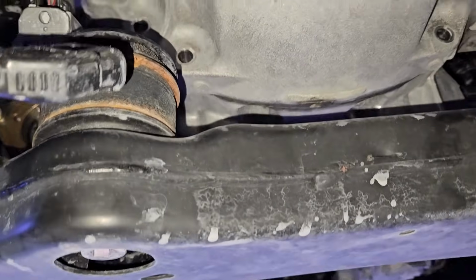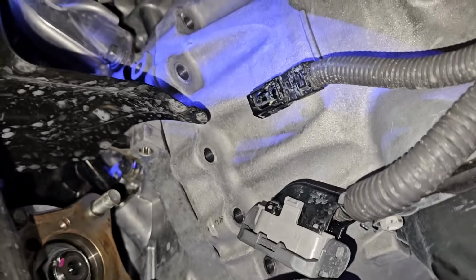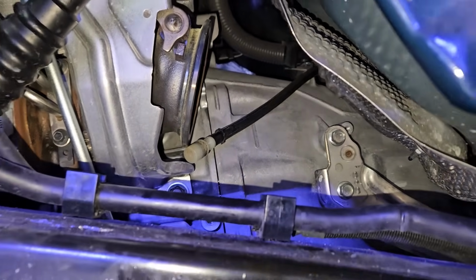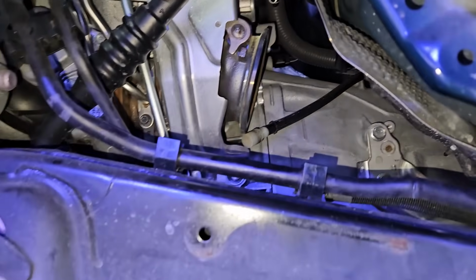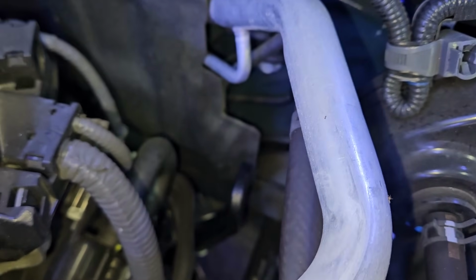Now I got the 14mm bolts around the bell housing on the transmission removed. I also have the torque converter to flywheel bolts inside of the engine, where you saw near the starter, removed as well. And that opening around the wheel housing liner, like I said, that's where I get the other top bolts on top of the transmission. Now, after all of that, we're pretty much ready to remove this engine from this truck.